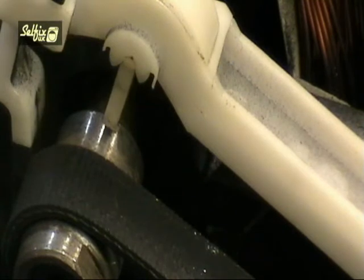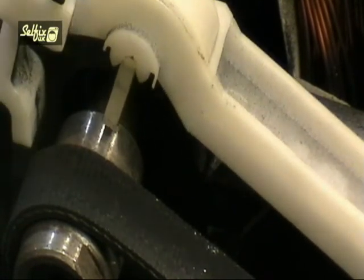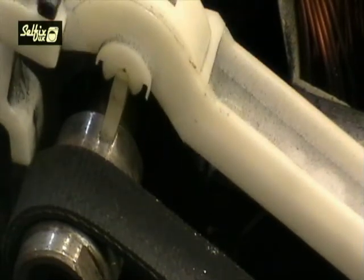At the other end of the cable is the pecker assembly, which is attached in this case directly onto the motor. If the motor shaft is not turning, the pecker can rest on it when the door handle is operated. This forms a type of bridge and transforms the inner and outer cables into a single unit. It's this union that allows the door to be opened.